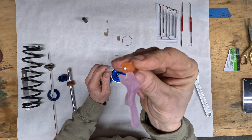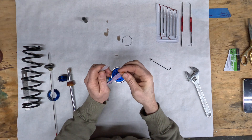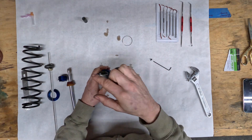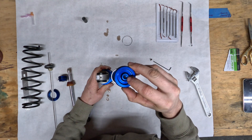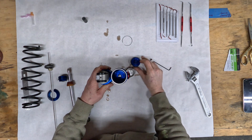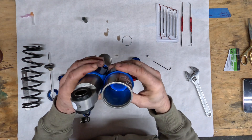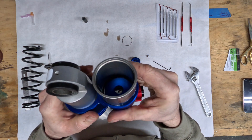Lucky enough I came across an actual needle. I was able to put the needle down into the pellet to relieve the nitrogen pressure — it worked really well and didn't explode or anything. That's a 25-gauge needle. These are self-healing pellets, so once you puncture it, it shouldn't leak. And even if it does leak a little, you have your retaining screw to keep anything from getting out.